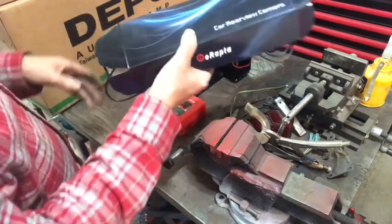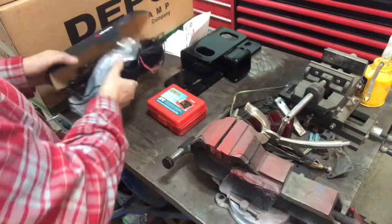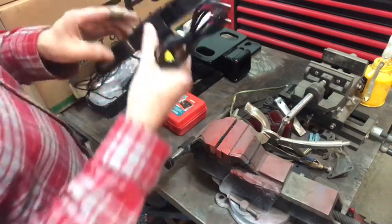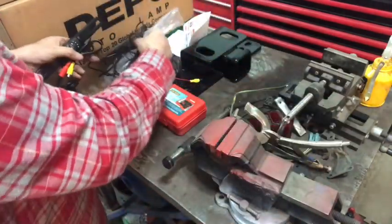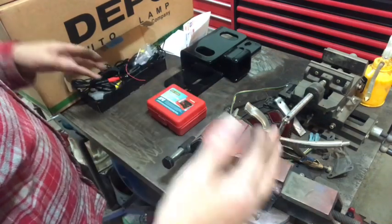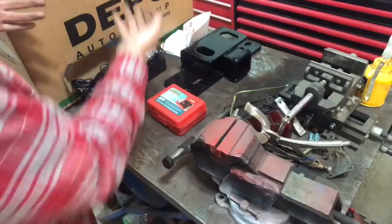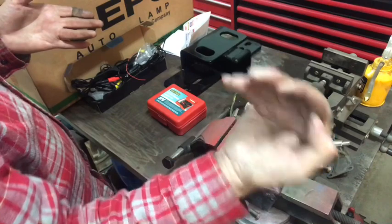This arrived in the mail the other day. It's a rear-view camera to attach to my stereo in the F-150. It's just a little camera that mounts to the license plate. It connects to a big long cable — there's plenty long enough. It'll run from the bumper of my 8-foot box, all the way underneath along the frame, into the engine compartment through a grommet in the firewall, and back behind the dash to connect to the stereo.